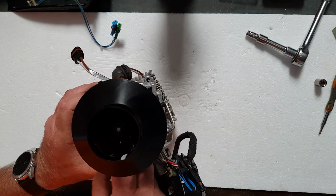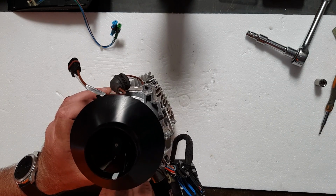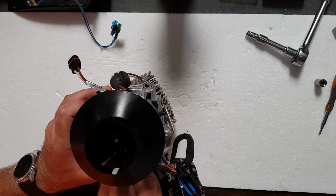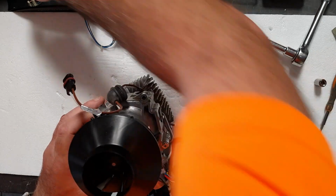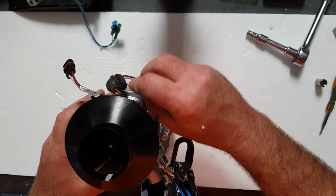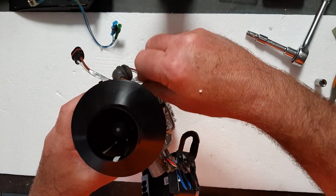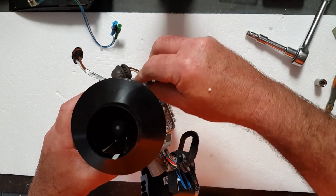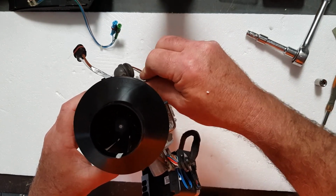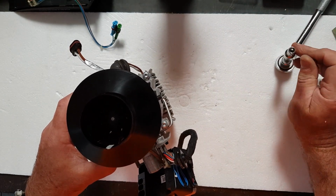because it doesn't get hot up this end of the heater as much as it does at the other end during the burn chamber, which makes that gasket that's in the burn chamber, the silver warmed one that I've put in there, subject to a fair amount of heat, making it brittle over time. We haven't serviced our heater. The last time we serviced it was about almost 3 years ago, so we've kind of left it probably a little bit longer than what we should have, and that's probably why we were blowing some smoke.